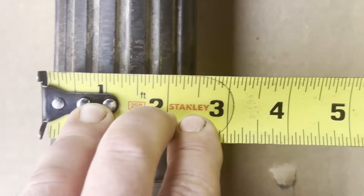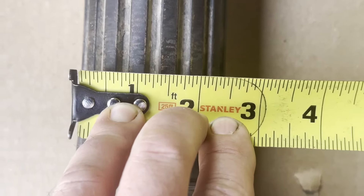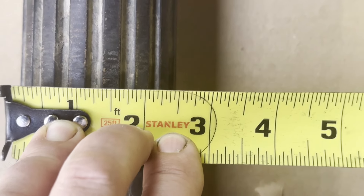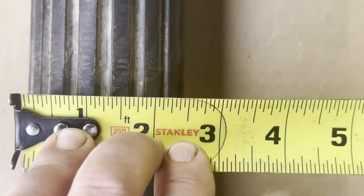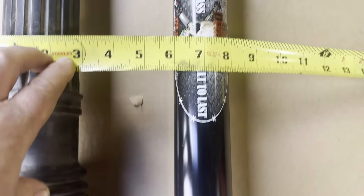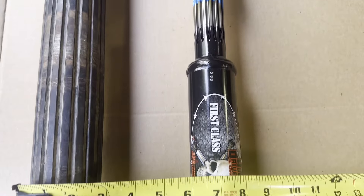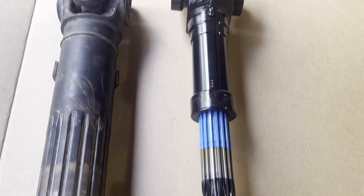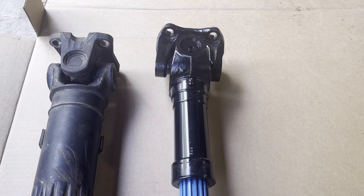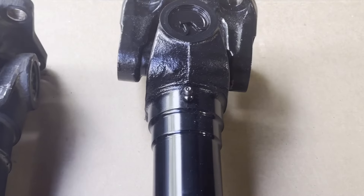You can see the Adams drive shaft is two inches thick. The stock shaft is two and a half to two and three-quarter inches thick, so you gain some clearance on full droop. One of the great things this drive shaft is noted for. This is the OEM flange style extreme duty. It has one grease fitting only, right there on the slip yoke.